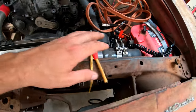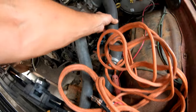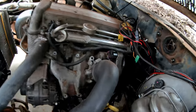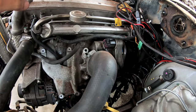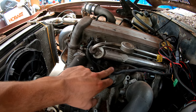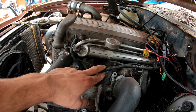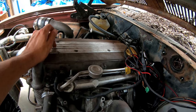Intercooler, plumbing the air through some Saab soft tubing back into the throttle body. Now, the throttle body for the Saab has a different number of pins, so that had to be rewired. The injector harness, we swapped to 80-pound eBay injectors, EV1 style, so they were 10 bucks a pop, really cheap, but we had to get the harness for EV1. If you don't want to make one yourself, you can buy them off, I think, ZZP for like 25 bucks, pretty reasonable.